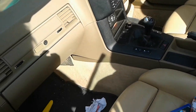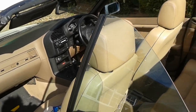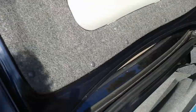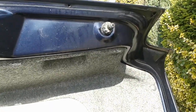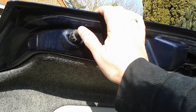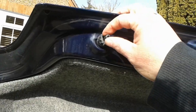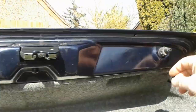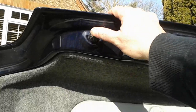I started the engine because I prefer to have the engine running when I'm doing the hood, so it doesn't drain the battery too much. What I did to solve the problem is that these two things here, which I assumed would be sensors tied up with the electronics to confirm to the management system that the boot — or trunk as you call it in the States — is shut down, were a little stiff. I put some WD-40 lubricant on them and pushed them in and out again to make sure the lubricant was in there.